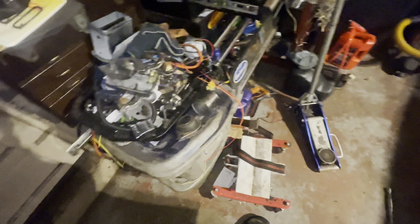I want to show you why we're even rebuilding this rear. The car is in first gear right now. I'm going to put this breaker bar on one of the lug nuts and I want you guys to see how much this car moves. There is a really nasty noise from the rear end when you're decelerating — no noise when accelerating, but when you're steady on the throttle doing like 65-70 mph, the rear just grinds the whole entire time.